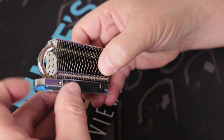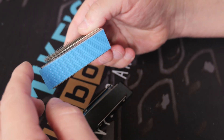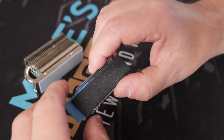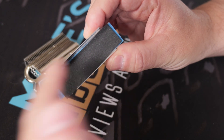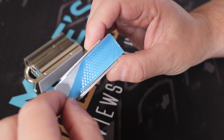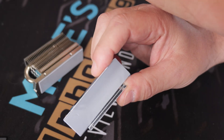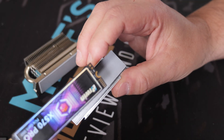When that's loosened off, you can remove the bottom plate, and you'll see there are thermal pads on the bottom with a protective strip — make sure you remove those. For the bottom section there's also a foam pad. If you've got a single-sided drive you can potentially use the foam pad, or if you've got a double-sided drive you can remove the protection on the bottom there. The drive I've got is a single-sided drive.